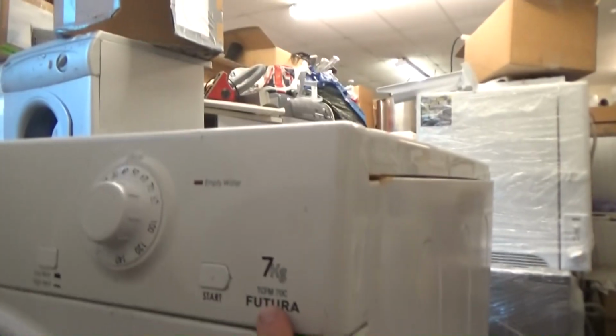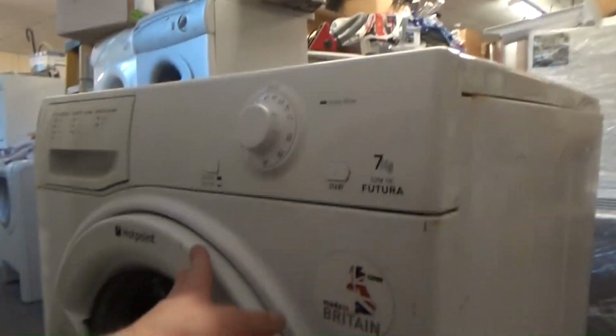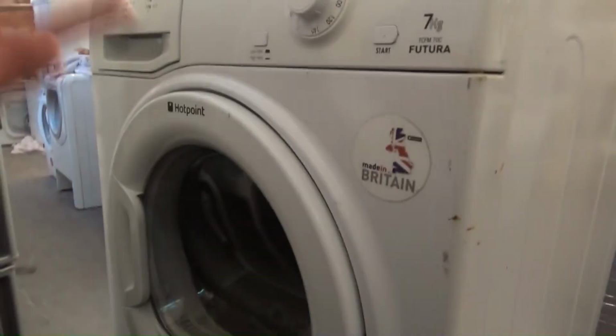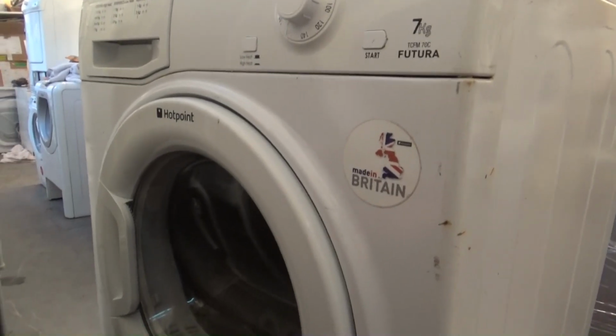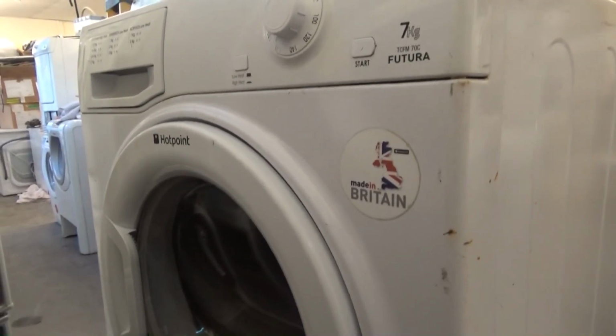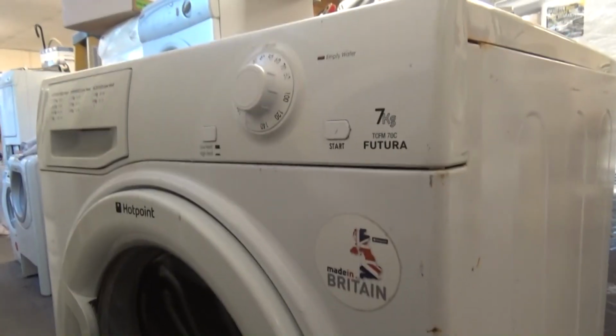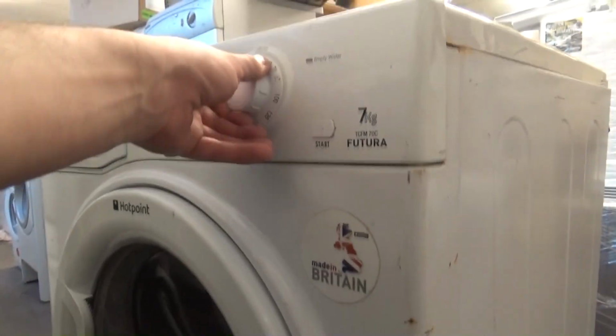Right, this Hotpoint dryer. What model is it? Now this story begins about 6-7 years ago. I didn't actually know what was wrong with it, but some people thought elsewhere. So this was turning half turns at the time. I'd been given it to fix, and it just seemed to work fine. I was like, what is wrong with it? Then I plugged it in, ready to go back, and it started doing the half turns again. Turns out it was the timer.